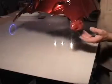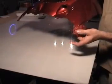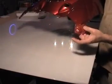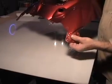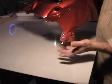Keep in mind that the longer you leave the tuck tape on, the more chance there is of leaving some red adhesive residue behind, easily cleaned up with alcohol, some wax and grease remover, things of that nature.